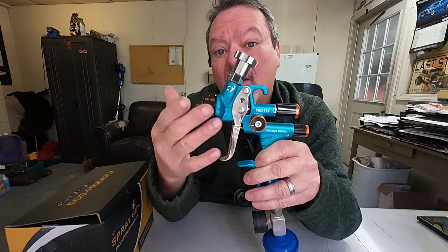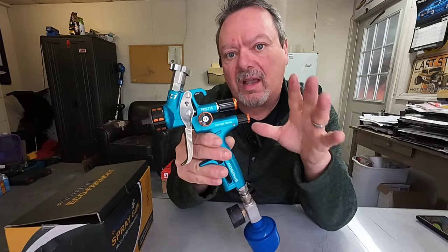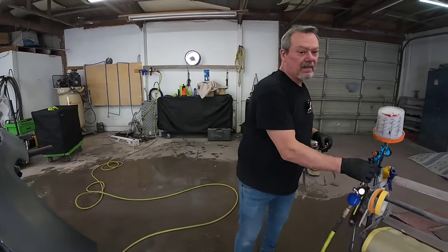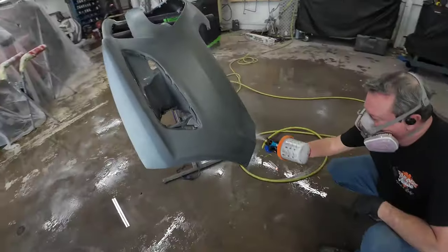You can check this gun out and all the guns they have on their website. I'm gonna leave that link in the description in case you wanna check it out and see what kind of guns they sell. So let's take this out in the garage. We'll spray with it. We'll talk about how it performs. So I've got it set at 18 PSI. We'll get a good coat of sealer on here and then we'll move on to base.